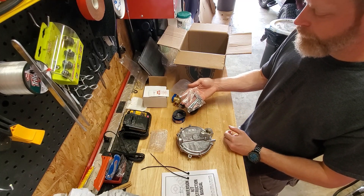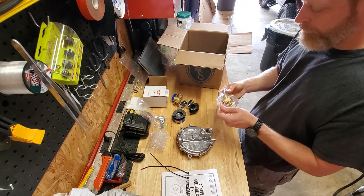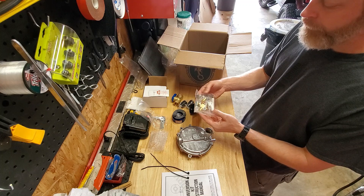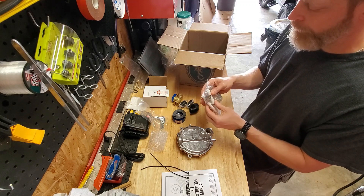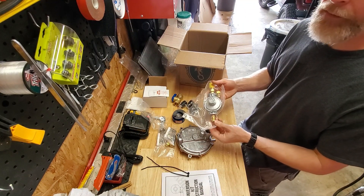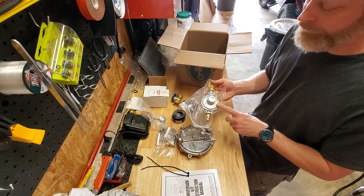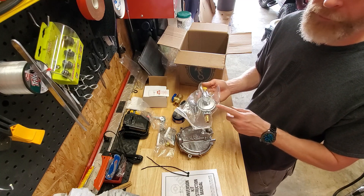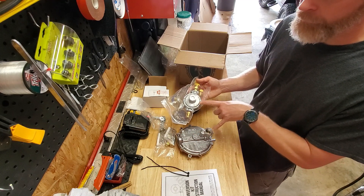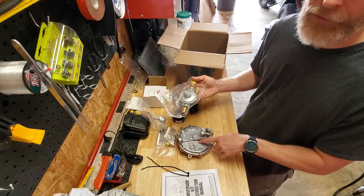This kit has all the nuts and bolts hardware. I'm going to leave those in there so we don't lose any. This one has some more fittings, some threaded studs, some hose clamps, and a little bit of pipe. This is the other regulator that's included. This regulator allows you to run the high-pressure propane cylinders that you would normally use for a barbecue grill or crawfish cooker or something like that. This kit needs both regulators when running high-pressure. Only this regulator if you're running the low-pressure natural gas you would get from a house feed.